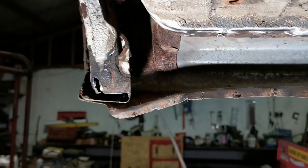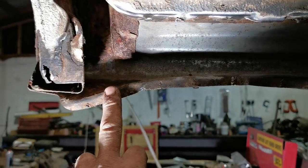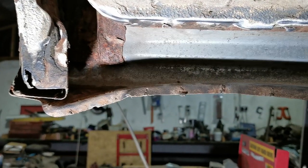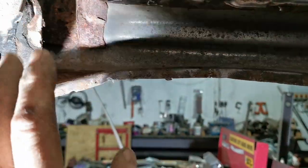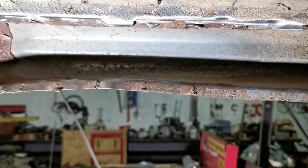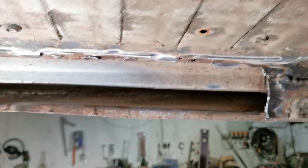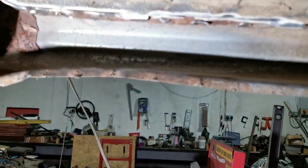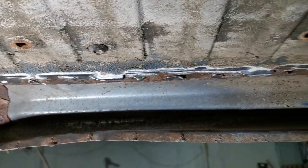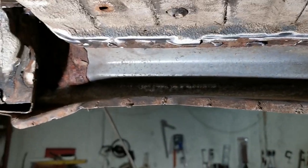The biggest issue is just here, and you can see that it's not the right shape. So someone's clouted that on a pavement or jacked it at some point earlier in its life. And what that's done is deformed the sill, probably quite a long way out. So I'm probably going to have to get a slide hammer on that and just bop it down a bit. And then hopefully the section which we have, so I've started cutting down, which is just here, will weld in reasonably easily. I've got some holes to drill so I can puddle weld along the sill here because this is still quite good metal. And then we'll have this off so we can get a nice flush fit tight up in here, and we should be good. Okay, we'll see how we get on.